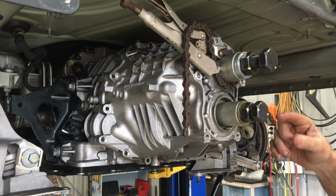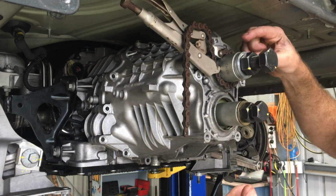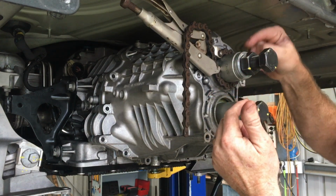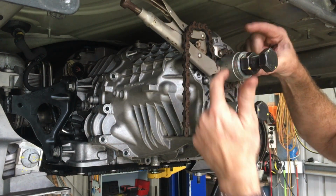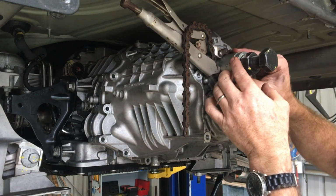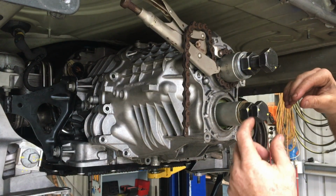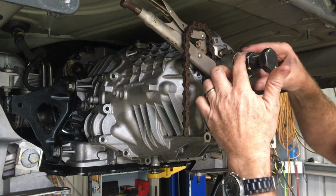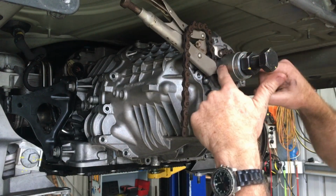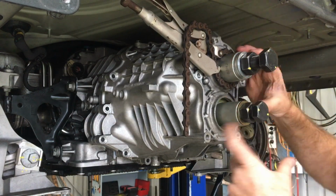And also what I found was when I was turning this top one here, because obviously there's friction in between the washers here, this was turning this bush removal tool, which I'm using to pull the rod through. If that's turning, it means it's not actually pulling the rod through. So what we needed to do was hold that in place. All I've done is use something like a vice grip, but with a chain, hold that in place. That just holds up against there, so that held it in place, so it pulled it through evenly.